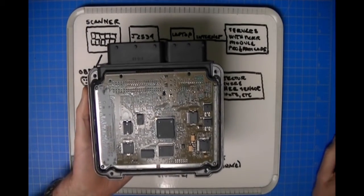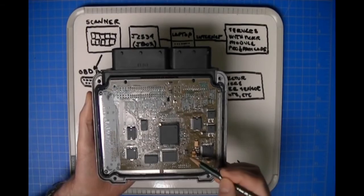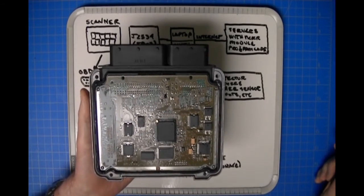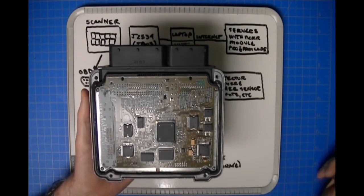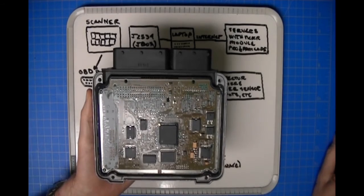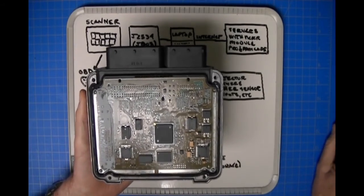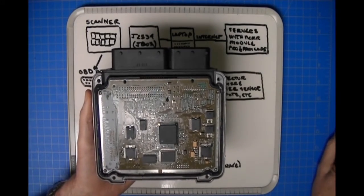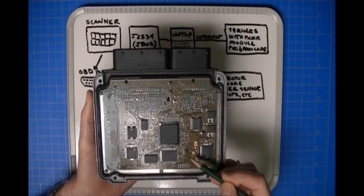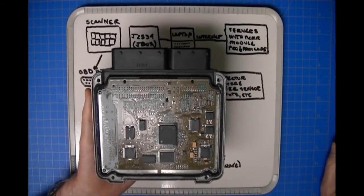So what do you do? Well, with EEPROM Work, you use a product such as our Automotive Kit. You attach to the EEPROM, you read it, and then you attach to your target module from the salvage vehicle, and you program it. Assuming that the salvage vehicle doesn't have any other defective components, all you have to do then is install it in the car, because the program in the flash memory is the same, and the processor is not going to know that the module is a different module, because the information that it's going to reference is here. You've just moved the information from the vehicle with which you're working into a salvage module.